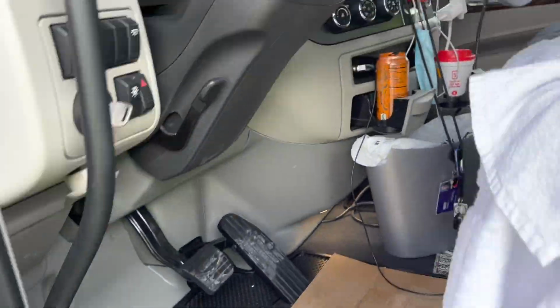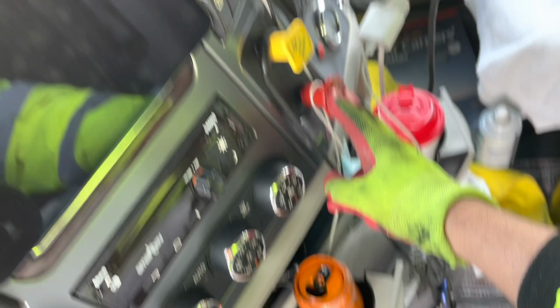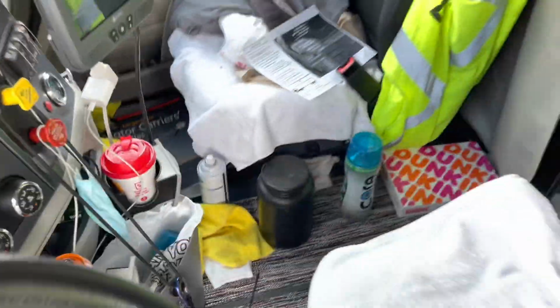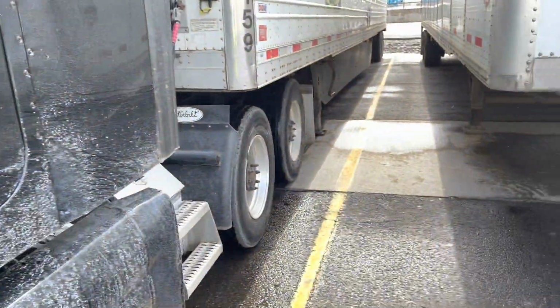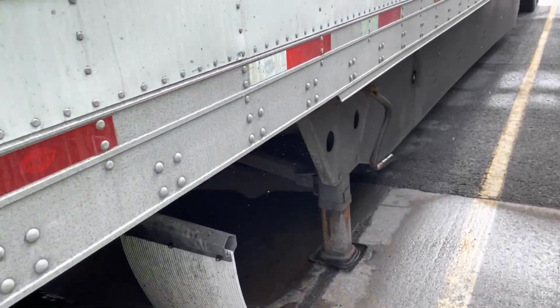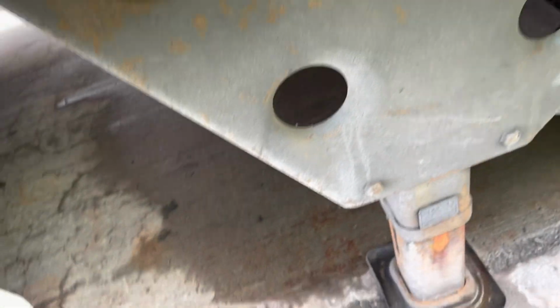I'm going to go in here. I'm going to air up the trailer by pushing in the tractor, the trailer, or the red brake. Push it in. It's going to start airing it up. Now on this load, I also need 2 load locks. But let's first raise the dollies. Again, slowly in.